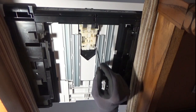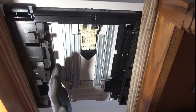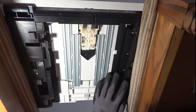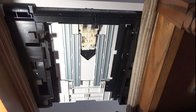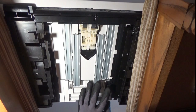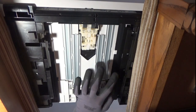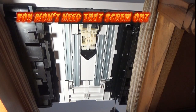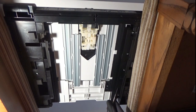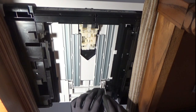Okay, so underneath here: this part is your back and this is your front. You're not going to worry about this side — you're going to worry about the side which is the left side looking from the front, or the right side working from underneath. We're just going to focus on the side that has this one oddball screw. Before we take that screw out, there are one, two, three, and four screws on a plate that's covering six screws underneath, so we'll take off those four, then the six, then that one.